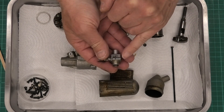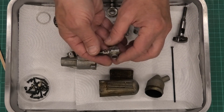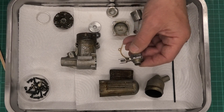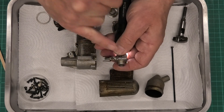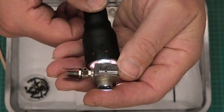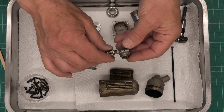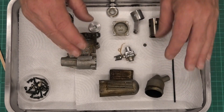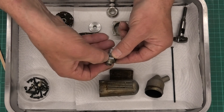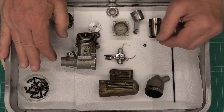The other thing to note is the air bleed hole here. Before I touched the air bleed screw, assuming this engine was set up correctly when it was running, the air bleed would have been at the right position. So I used my torch and shone light up through the venturi and had a look with a magnifying glass to see how far the hole was blocked by the air bleed screw. It was almost 50% covered - perhaps about 45% covered, so about 55% open. I'll try to mimic that when I rebuild the engine.